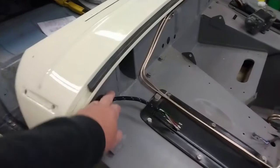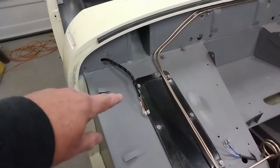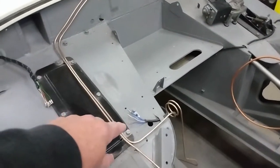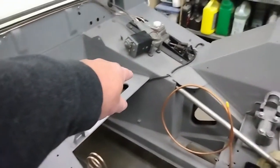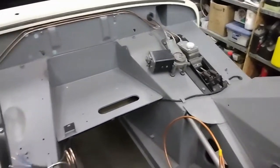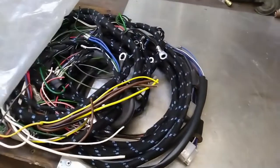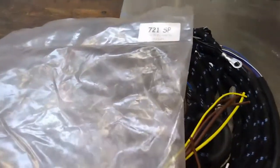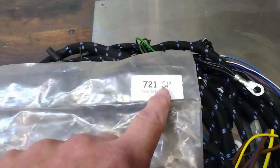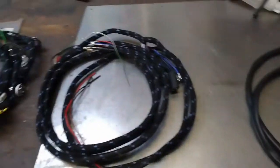Here you can see the back part of the wiring harness where it comes through the firewall — there is a grommet on the main part of the harness that I'll show you in a minute. This section here wasn't the first part of the harness I've installed; in an earlier video I refurbished the dimmer switch and ran the wiring for that, and that terminates here and just runs down underneath the battery tray, across the bottom of the master cylinder and then down into the footwell. There are two or three more pieces to go in, and here's the rest of the wiring harness — as I mentioned, it was made in England by AutoSparks. I'll have the link in the description below, part number 721 SP.